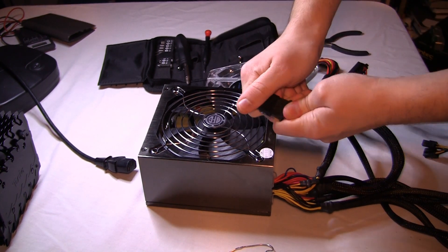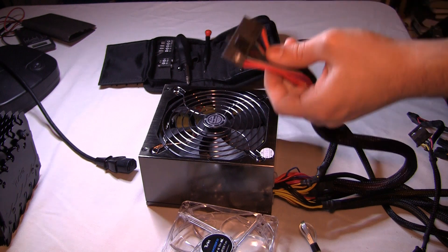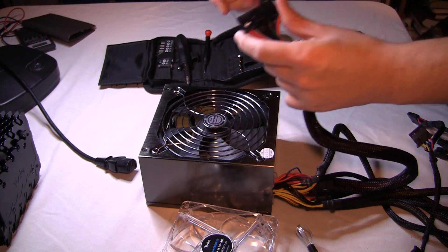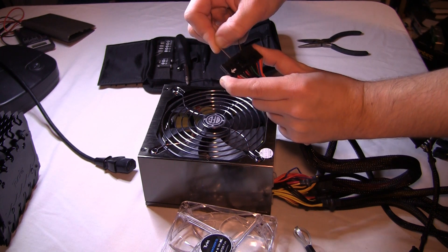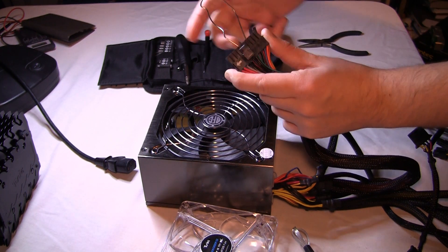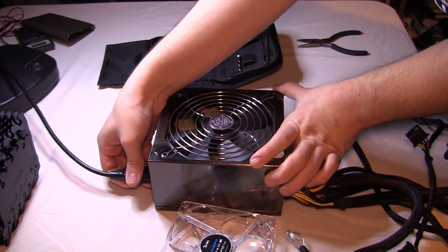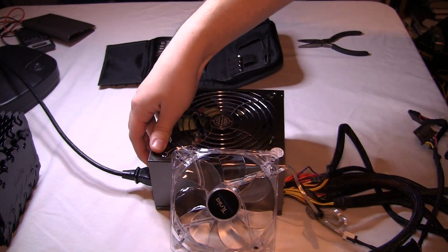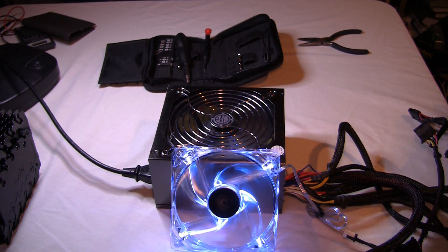OCZ normally is the one that causes trouble, and some others do as well. You may need a couple fans — you might even want to plug a hard drive in there — just plug it into the power supply and then turn it on. It doesn't need to be in a system or anything like that, it just needs to spin up. So here we go, I'm reconnecting the green and the black wire, and it has to be green and black. There's minimal risk of shock because these power supplies are designed specifically not to cause those problems, but if you want to be safe, unplug everything. And sometimes capacitors can store a charge, so you might want to use pliers if you want to be ultra safe, but you should be pretty in the clear here.